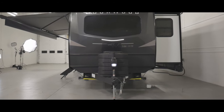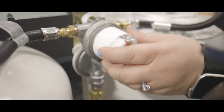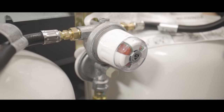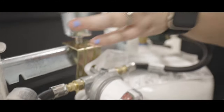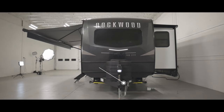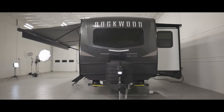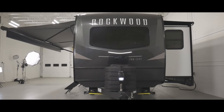On the very front of the trailer we have the tongue jack, battery disconnect switch, LP tanks, and LP tank regulator. The LP regulator has a changeover lever on top to control which LP tank is primary and secondary. The regulator has an indicator that will turn red once the primary tank is empty, and the regulator will automatically switch to pull gas from the secondary tank. When you are ready to remove the LP tank to have it filled, make sure to change the regulator over so that the empty tank is set as the secondary tank so that you can remove it safely without losing your LP supply. The battery disconnect switch is located on the side of the frame. It should be on when you are using the RV, but when storing the RV we recommend switching it off so that your battery is not drained while not in use. It does not cut the power from the RV solar system, so the solar can still charge and maintain your battery while the RV is being stored.